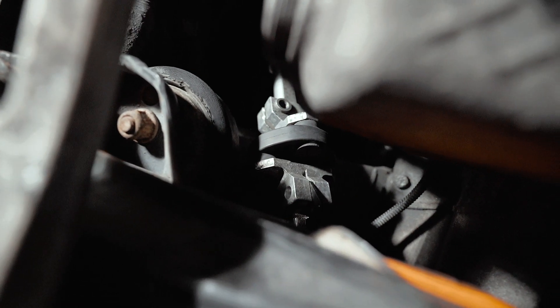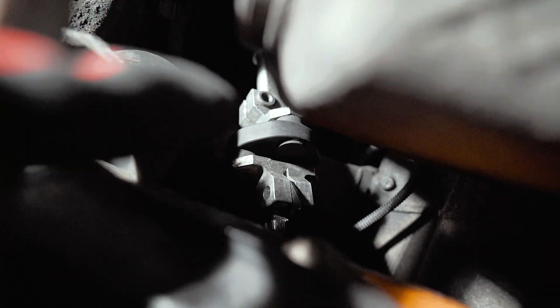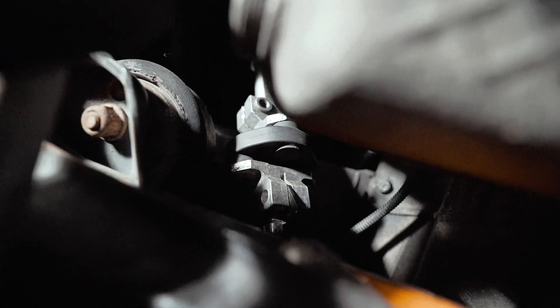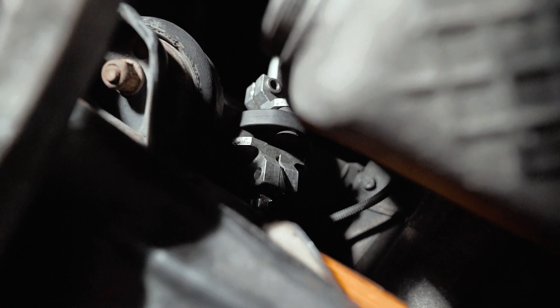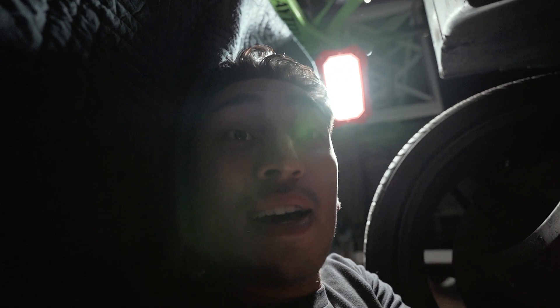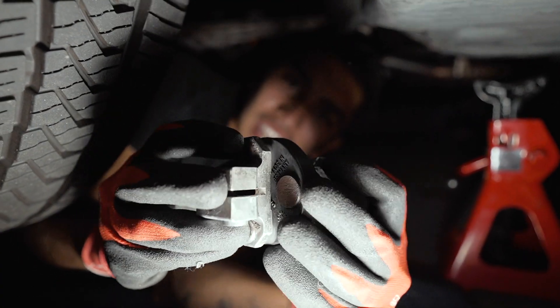As you can see right here, that's the steering coupler. There's a bolt on top and a bolt on the side — go ahead and remove those and pull it up. It's as easy as that. This one is already pulled up, so all I've got to do is slightly remove it. There is a black piece of plastic that you want to line up everything with so that it sits on properly, and you should be good to go.